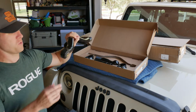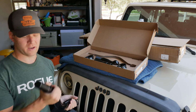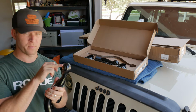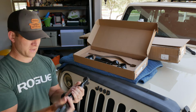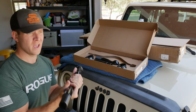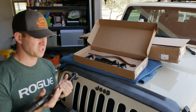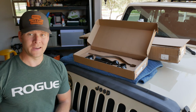I'm really hoping this is gonna fix it. But in addition to needing to upgrade for the bushing reason, I figured while I'm there, there was a 4th of July sale, and I figured I'd capitalize on it. This is the Steer Smarts Yeti XD Pro Trackbar. What's cool about this is it has polyurethane bushings instead of rubber bushings, so they definitely should last longer. It is fully adjustable. And I know you guys can't tell, but this thing weighs a lot. This part of the Trackbar itself has to be at least 20 pounds, maybe even 30 pounds. It's over 1.5 inches thick, almost closer to 1¾ inches, and it is absolutely burly. So this should take out any kind of slop I have between the frame side of my Trackbar and the axle, and I'm gonna go ahead and get this installed today.